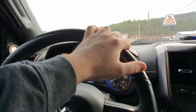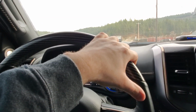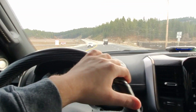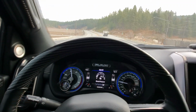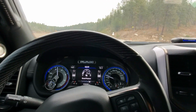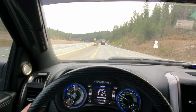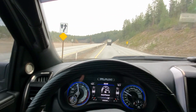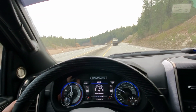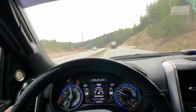And like I suspected, those leaf springs pretty much do nothing but keep that axle in place. Just out of curiosity, I dumped the valve all the way, and once the airbag is deflated, the back end sunk another good 6 to 8 inches. So anyways, long story short, that's what it took for me. I'm just sharing my experiment, and hopefully this will help somebody out there dealing with these airbags.